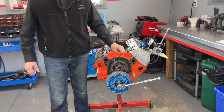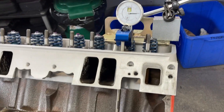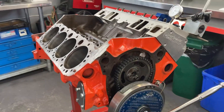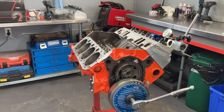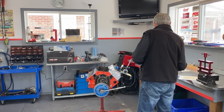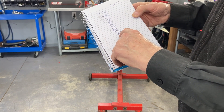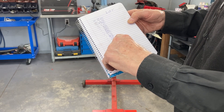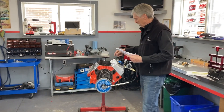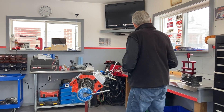Here's our little jig setup. As I mentioned in the previous video, I use a solid valve lifter — if you don't use a solid valve lifter, the lifter will collapse with spring pressure and you'll never get a meaningful measurement. I use my dial indicator, set at TDC. The valve on this camshaft starts to open at 26 degrees before top dead center, so I start measuring at 20 degrees before TDC. We start at minus 20 degrees, then minus 10, then TDC, and every 10 degrees after that. 106 degrees is the center line of this camshaft, where we measure maximum lift.